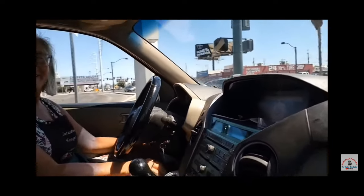So we'll reset that oil light when we get back. Now we're at 327,000. We actually wanted to do a filter change a little bit earlier — preferably at about 5,000 miles — but she drives all highway mileage, which is actually easier on the car than city driving. So the oil looks to be in great shape. It burned very little oil — maybe half a quart in 13,000 miles — which is impressive for the miles on this rig.